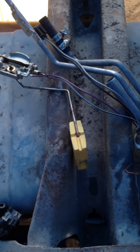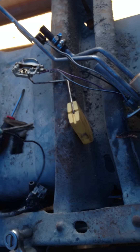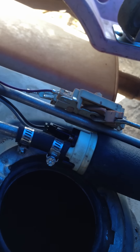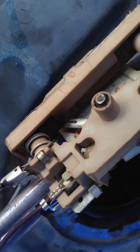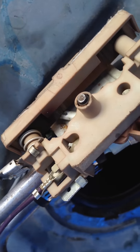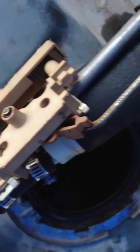What I did — I bought another used fuel sender from a salvage yard. This is what I'm talking about right there — see this little plastic piece? That's what's missing on the old one. This new one has this plastic right here, and whenever it moves, it goes along those lines. You can see that little white stick moving along the coil over there — that sends to the gauge how much fuel you have, either empty or full. On the old one, that whole system is completely gone.